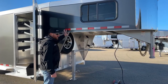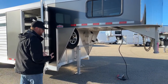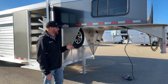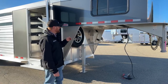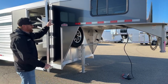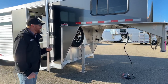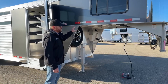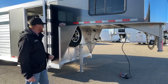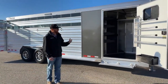On a lot of competitors, the standard has been a 50-inch gooseneck drop wall height. In these newer pickups — especially Fords, Dodges, and GMs with their new body style — bed heights have gone up. Who wants to tear up a bed on a brand new truck that costs $85,000, $90,000, almost $100,000? So what we've done is make this a 53-inch gooseneck drop wall height. Yes, it does eat three inches into that gooseneck, but now we can make sure this trailer is running level with plenty of bed clearance. On those 50-inchers with newer trucks, you'll see the trailer running level with hardly any bed clearance, or actually nosed up and running on the back axle, which we don't want.